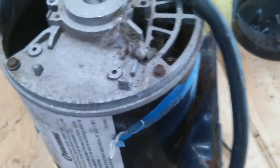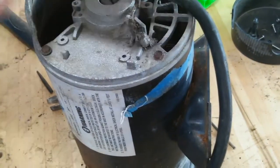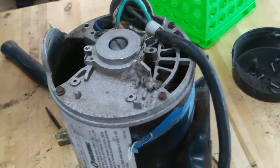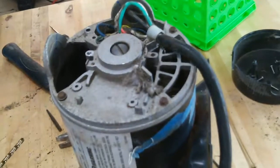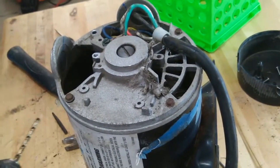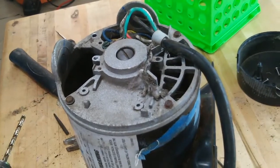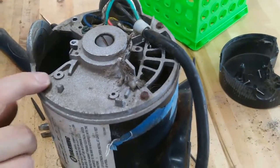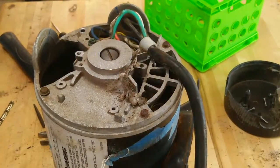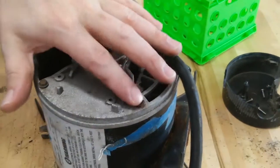So what I'm going to do now is use my drill and drill out the head of this bolt off, and I'm going to do that to all four bolts. That way I can pull off the rear end bell and slide the front out. Now, a couple things to remember: you're going to need a cobalt drill bit. You cannot use a regular steel drill bit, because these are hardened steel through bolts, and if you use a regular drill bit it will not work. You cannot use a wood drill bit either. So you need to go to a cobalt drill bit, and you need to center punch it.